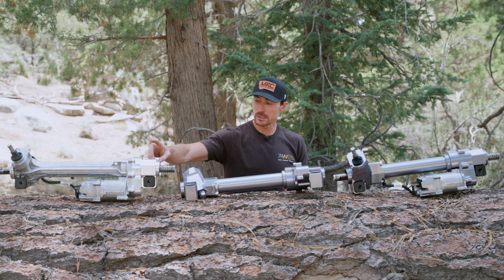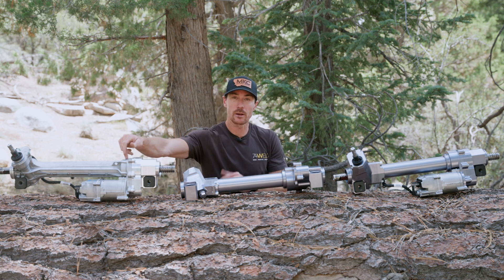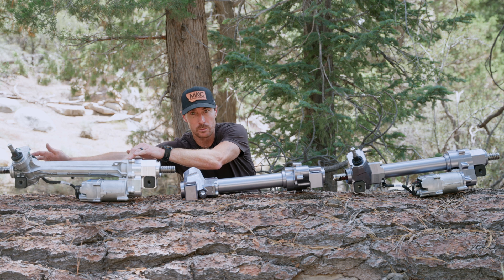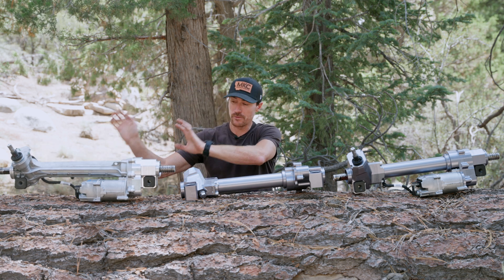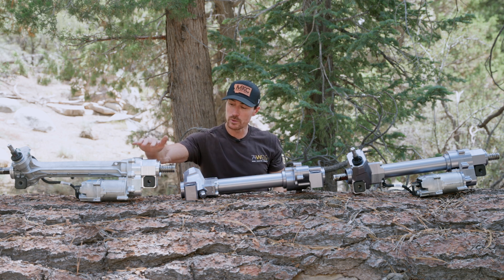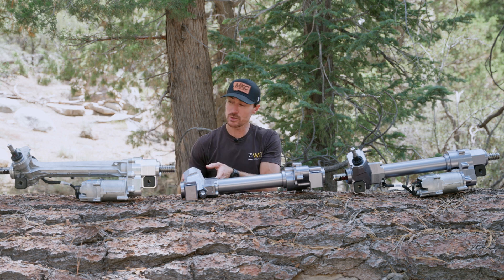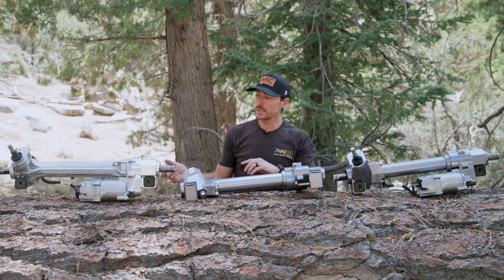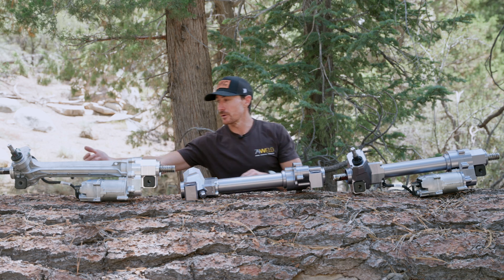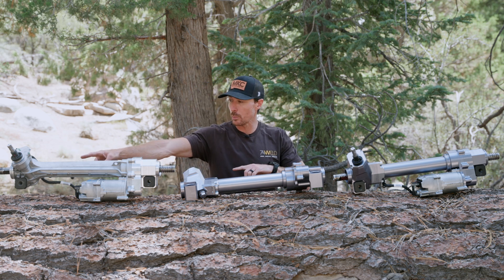What this does is it gives support. You have an angular contact bearing that rides on a linear bearing right here — that's your only point of stability on the factory rack, with the exception of a plane bearing and a load bolt on this side. If you want to know all about the factory rack, we'll link a video down below on a deep dive into this platform. Stage one gives you a cap that has an oil-impregnated bronze bushing inside, adding stability to the passenger side of the rack. On the driver side, we did a different take than anybody else — two different types of materials in a bushing that slides and taps into this side of the rack to stabilize and give additional support on the pinion.